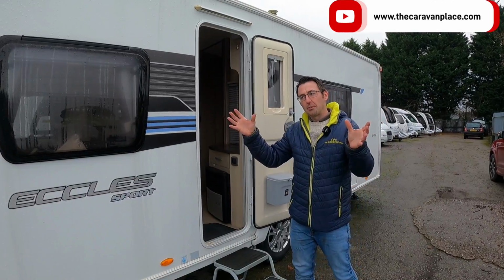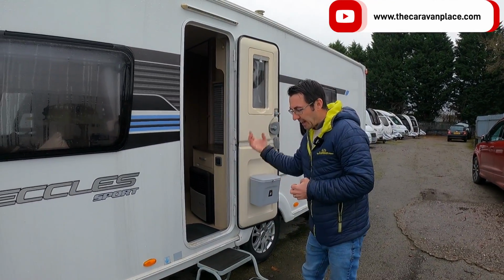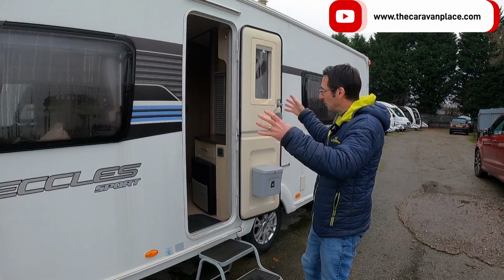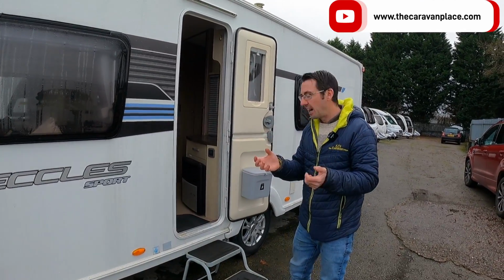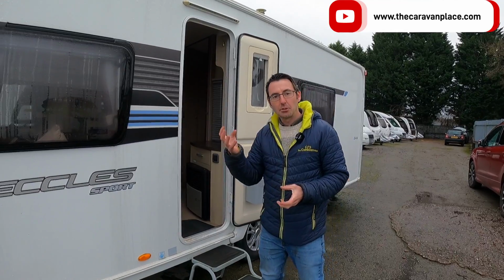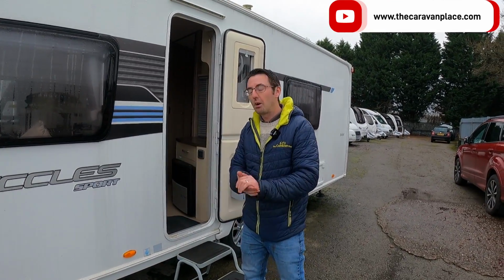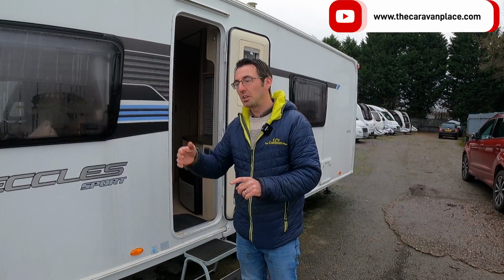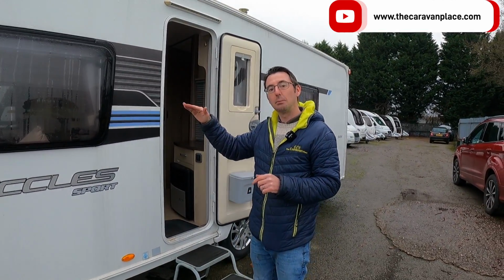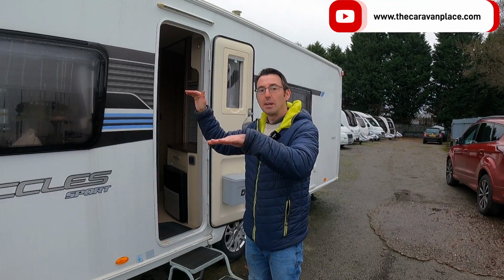So again, one of probably the very, very first things really is trying to figure out, once we've got our layout right, we've found something that we think is going to work, it's got all the right things that we want in there, it then comes down to, can our car actually tow the caravan that we're looking to buy? So we need to know what our car can actually tow first, and then we need to work off the MTPLM, so the maximum weight of the caravan, compared to what the tow weight is of the car.